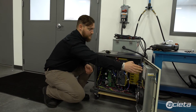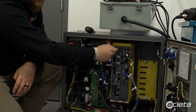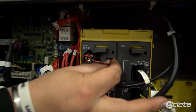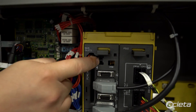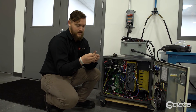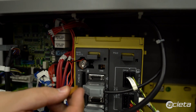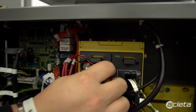That battery is located on the main board here, and the RAM battery sits right here. To remove that battery there is no specialty tool required. With a firm grip, grab close to the connector and give it a gentle pull out. After it has come out, replace it with a new battery. The way you took it out is the same way you put it back in — insert the battery into the holder, then take the connector, ensure it's inserted the correct way, and gently push it back into its home.